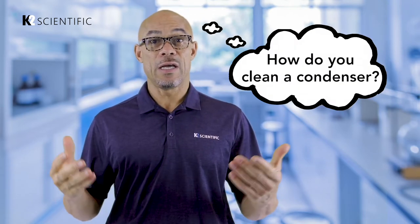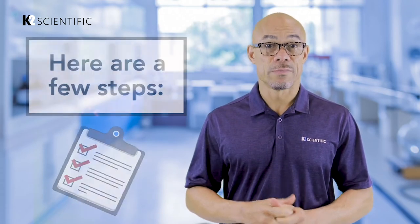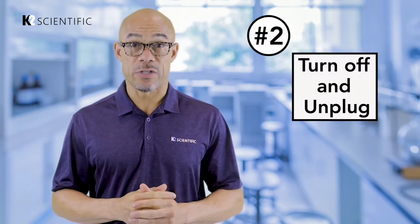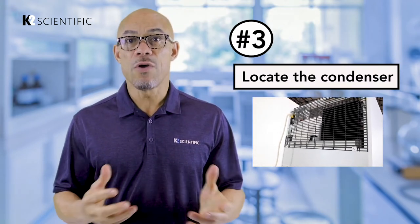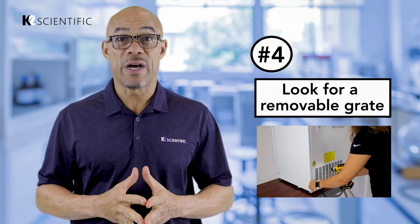So how do you clean a medical refrigerator condenser? Here are a few steps to take before you clean your condenser. First, remove the items from the refrigerator and place them into another refrigerator or storage device that will keep these items cold while you clean the condenser. Second, locate the refrigerator power button and turn the device off, then unplug the refrigerator to ensure it's not receiving any power. From there, you'll need to locate the condenser. The condenser is almost always located on the bottom of the appliance, although it will either be on the front or the back depending on the design of the unit. Look for a removable grate on the bottom of the device — the condenser grill is likely located behind this cover.